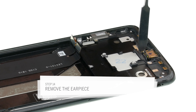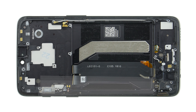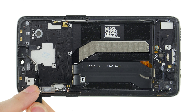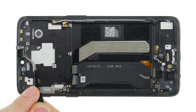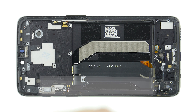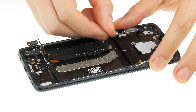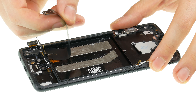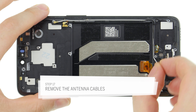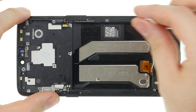Use a flat tool to lever the earpiece out of its socket and remove it. Take care not to scratch the sensitive front. The proximity sensor is glued a bit stronger. Use hot air if it cannot be easily loosened. At one corner there is a small gap where you can lever with a thin tool. Then remove the sensor. Heat the slightly glued display cable, then slowly pull the flex cable out of the device and remove it. First pull the black coaxial antenna out of its guide and take it out. The white antenna is hooked into the lower guiding. If it can't be released easily, grab a thin tool and carefully lever it out.